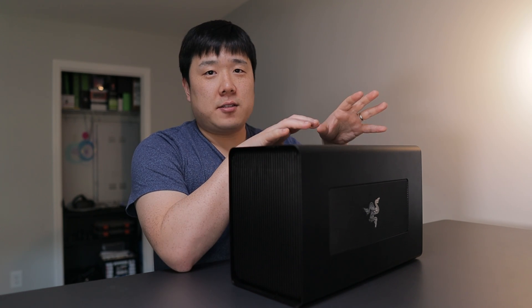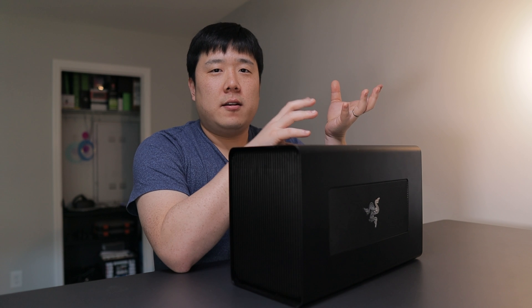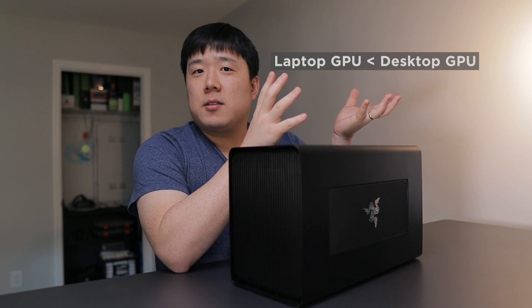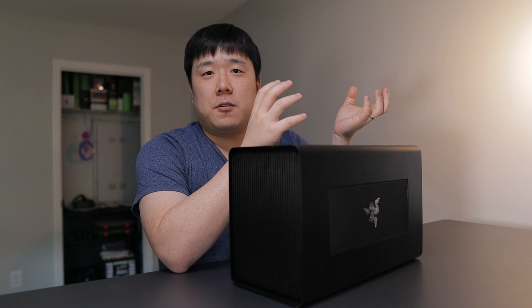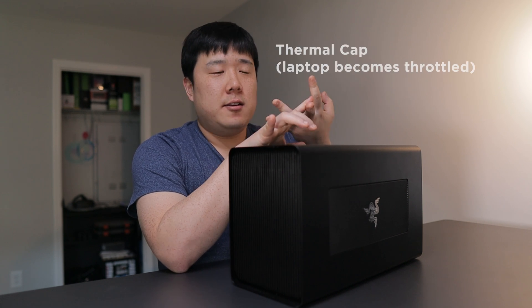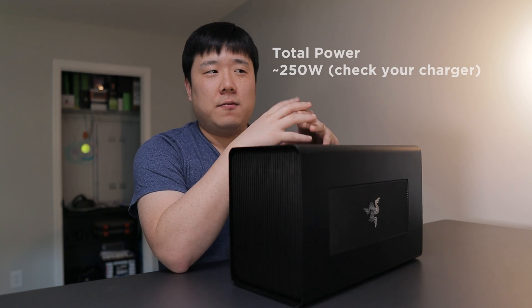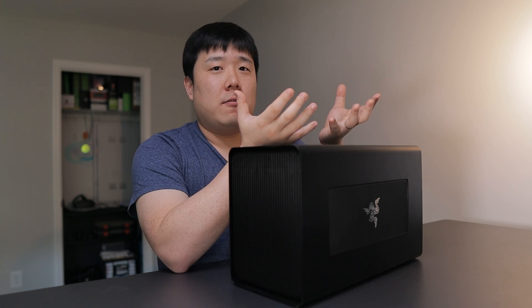Something we need to get out of the way is: why would you do that? The price for the enclosure and graphics card aside, what we're really after is performance. Regular users don't realize that graphics cards inside laptops are a downgraded version of desktop grade cards. You can expect a laptop GPU to perform anywhere between 50 to 100% compared to the same desktop graphics card. For example, if your laptop has an RTX 2070, it will have some form of Max-Q, low voltage, or throttling due to heat from sharing with the CPU, and your laptop is likely capped at around 250 watts total.